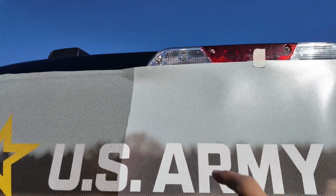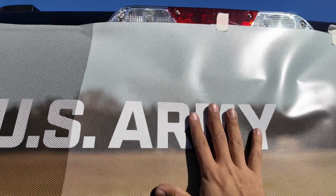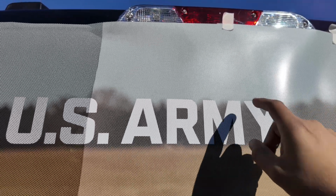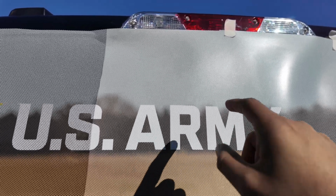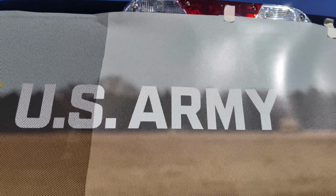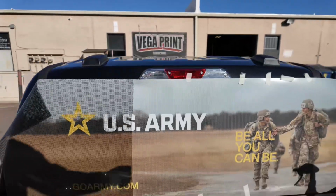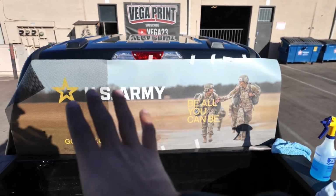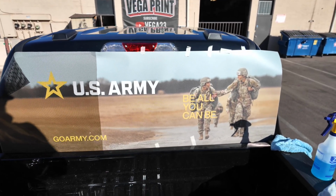For the middle window, I'm gonna do the same thing. I'm gonna cut around it, and then I'm gonna stick it to the back middle window, and then I'm gonna use the tip of the blade to cut as close as I can, because there is a window seal in between that little window. So we're gonna do basically the same thing from here to the other side. I'm gonna pull it back from this corner, take the backing, and then just apply it as I move over to the right side of the window.